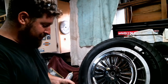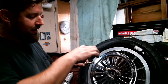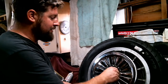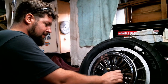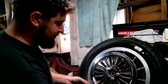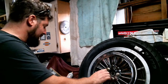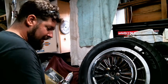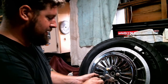All right, already started two bolts in here. Just get fully lined up and everything. Got some blue Loctite here. Put a little dab here if you can see it. Just one little dot there in the first couple threads. That's all you need. Thread each one of these in here until they're finger tight. Now we kind of put two of them in and snugged them up a little bit just to make sure the pulley and everything was centered. Had it flat while I did that, otherwise I wouldn't be able to stand it back up here. And the last bolt here. Some blue Loctite on the end there.